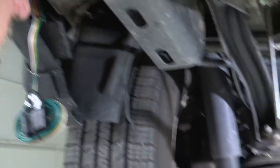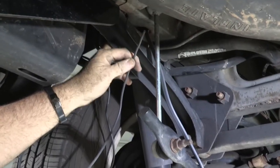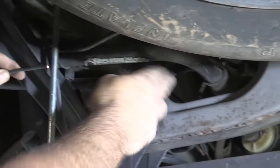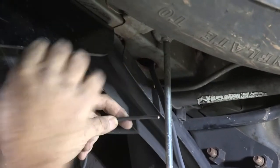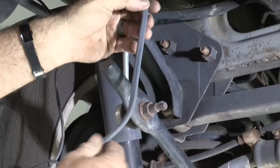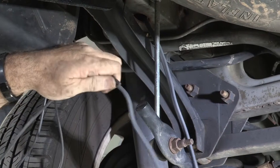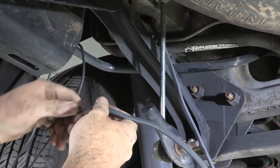We're ready to continue forward. Now I have our wire ran next to the filler hose for the fuel tank. I can follow the filler hose down to the brake lines which lead to the battery, or I can go inside the frame and run it down the frame. I like the frame idea — I took some heavy gauge wire and pushed it through the frame, ending up at the bottom toward the middle of the vehicle. I'll tape the ends and fish wire it through the frame. That makes the job a lot cleaner and safer.